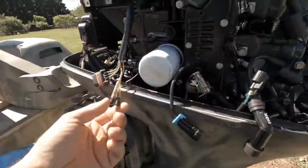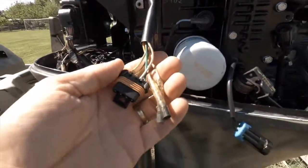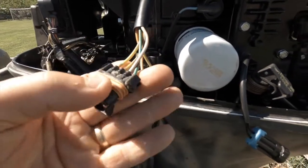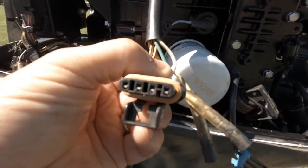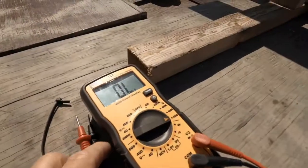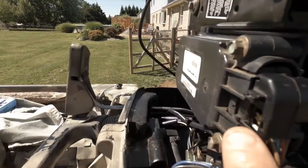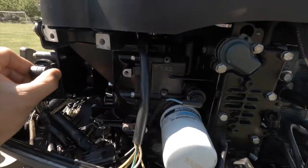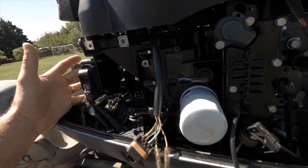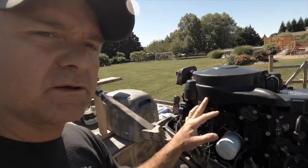This is the trigger — it's the all-white and red wires. This is your stator, and this is where you check ohms resistance between these two wires here. You definitely want to use a multimeter for this. I checked everything over and I originally thought it was the ECM. I unplugged the harness, checked inside, and resealed it — though you really don't want to do that because they're throwaways.